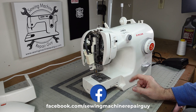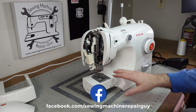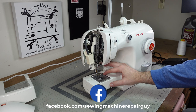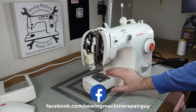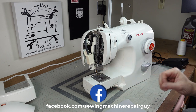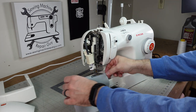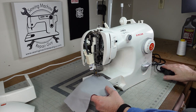We've cleaned up the inside of the machine and set the timing — the timing was off as you watched me fix. The other thing we had to do was adjust this needle plate because it was popping up on the right side. We fixed that with a little mechanical adjustment on the plate so now it's actually flat. We put a new needle in here twice now because the first time it was picking on fabric.